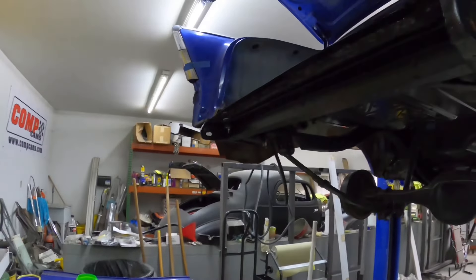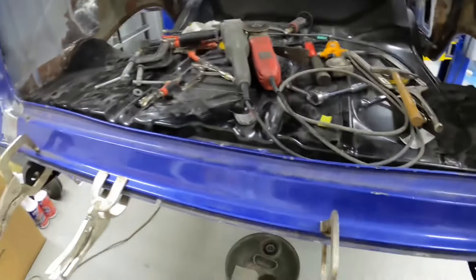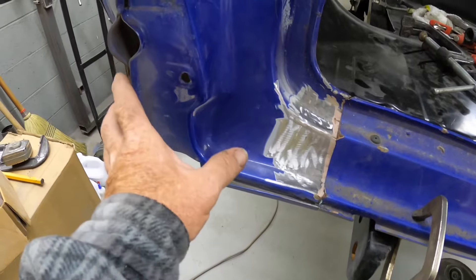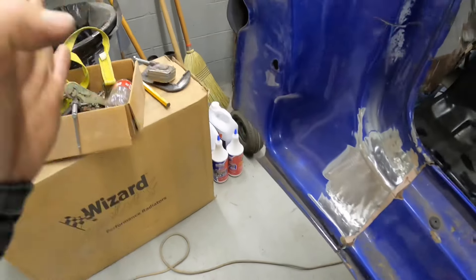We've got the floor pan bolted in - two bolts in here, one right over here, and one bolt over here. The next thing we're going to do is realign these corners - whoever did it just put them in without measuring anything. Here's the problem over here: they're not sitting in all the way. You can tell by how this goes out on the angle. So I'm going to break open these welds, sit it so the whole repair corner goes in. As you can see, it's got cracking here because they've just spot welded that on there.